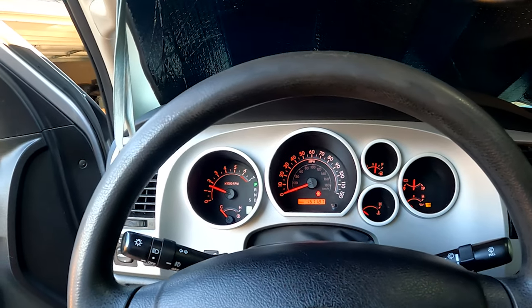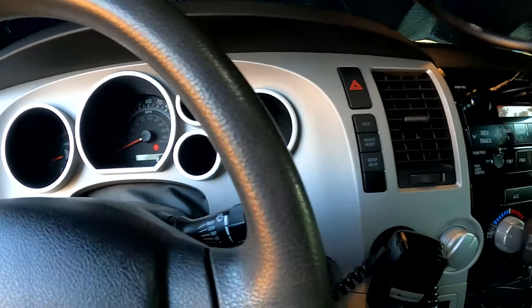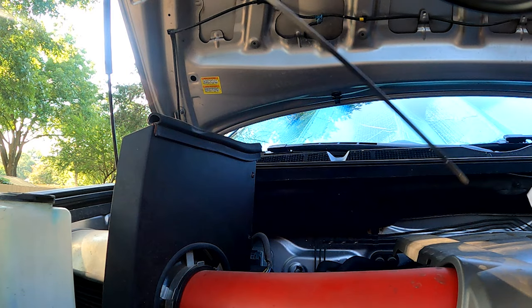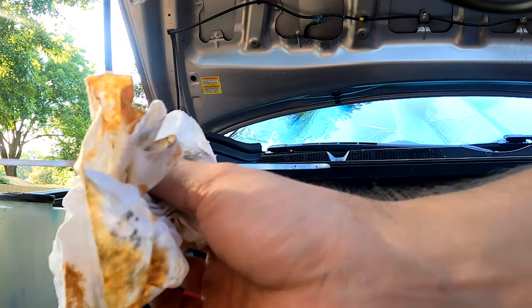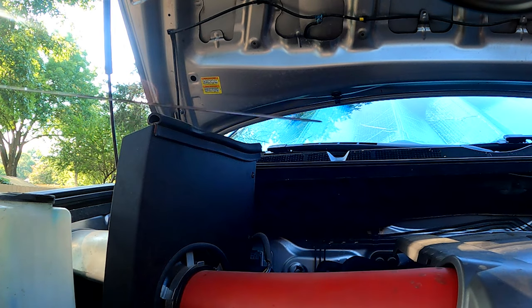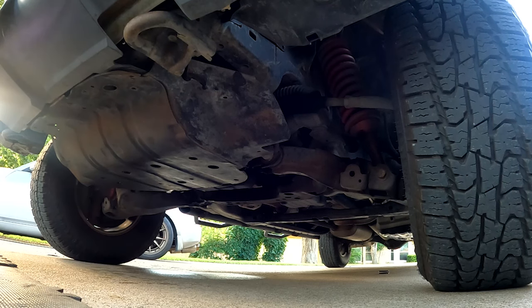Go start up the truck, warm it up, and make sure all the oil circulates and that you're still at the right level. Let it run for a minute, then shut it off and check the dipstick. It reads just a tad low, so add just a little bit more. Once you reach that optimal level, put the splash tray back on and the job is done. Thanks for watching — help yourself to a like or subscribe!